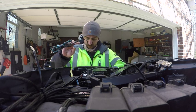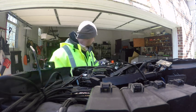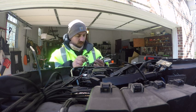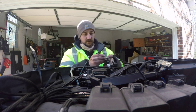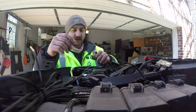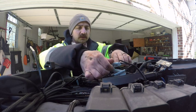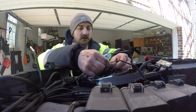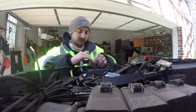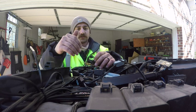This is driver's side bottom light. So wherever the thing is for that, it's way down there. So driver's side bottom, it's this guy. So with these, they won't work if you plug them in wrong. So white goes to white, and then black goes to black on here. And I have these labeled too, so this should be top. Because I want them working together. The fog's top. The only other thing is that all of these have to be grounded too. So what I'll do is run them all together and then probably just ground them straight to the battery.